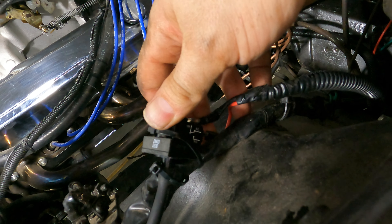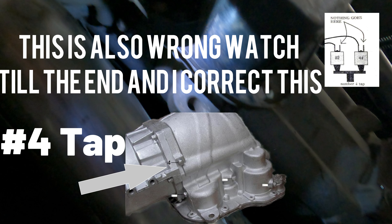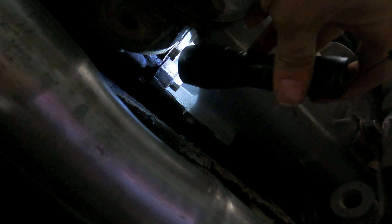Now that this wire is routed to the middle wire on our transmission plug, we can take our power wire, put it inside the loom, and connect both of these wires to our vacuum switch. We've got our two wires running on our vacuum switch — one wire on the NC and the other wire on the COM. They're always in contact until we floor it, and when it opens, our overdrive will kick off. So we have two ports we need to remove — one right here and one right here, plus a plug — and we're going to install both of our pressure switches.